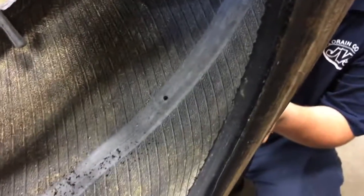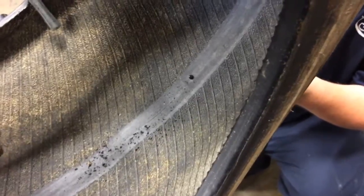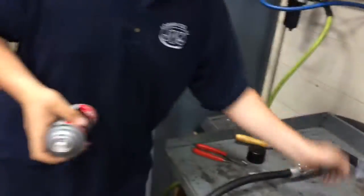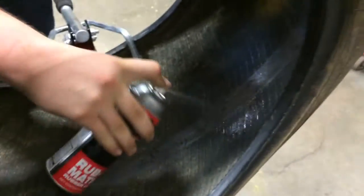You're going to push this button right here — it should come right up there. Keep the grinder up there. This is your tire inner matting. You're going to grab your little scraper here, you're going to clean that surface up, try to soften it up before you grind it. Just clean that surface up a little bit, get that dirt off there. You can see little particles where the dirt and the rubber from the drilling are.